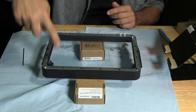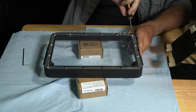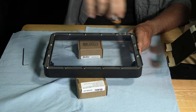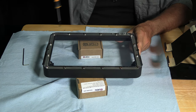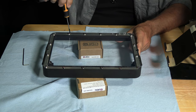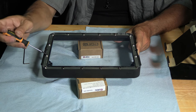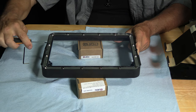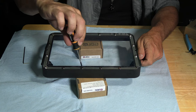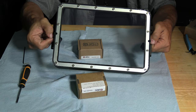I am going to do the centers and then the outsides to keep this from warping too much. Once you have all your screws lightly installed, go ahead and start to tighten them down starting at the corners. We're going to do it like lug nuts in a car — a star pattern. You don't want to keep cranking down one particular side and warping the bracket. Check to make sure your screw is at least below the vat level. I'm not over-tightening anything — once I feel like the screw wants to stop, we are done. You should have a nice taut and flat resin release film.